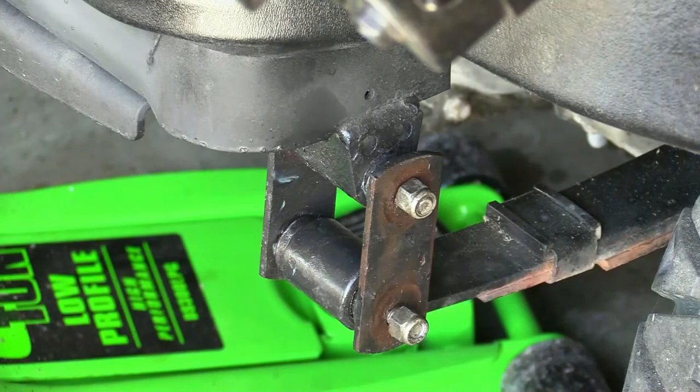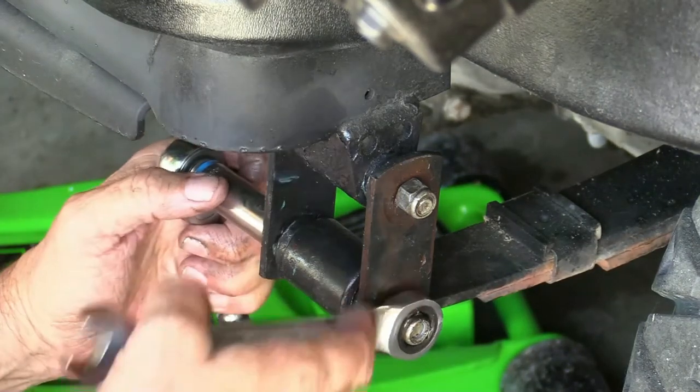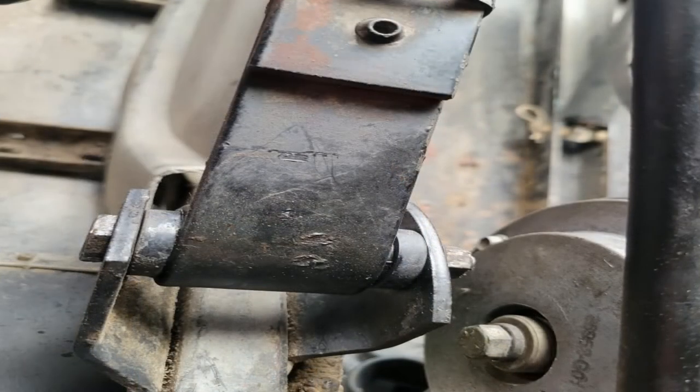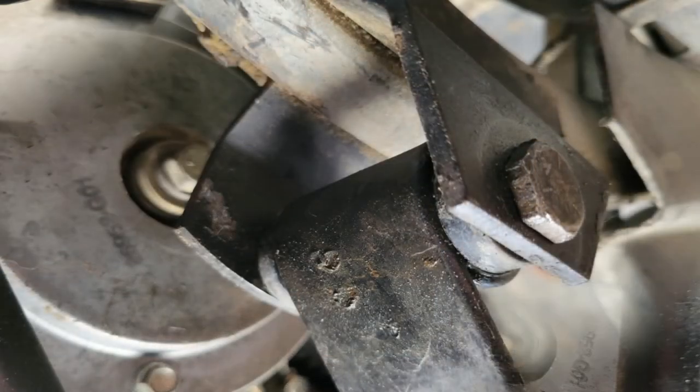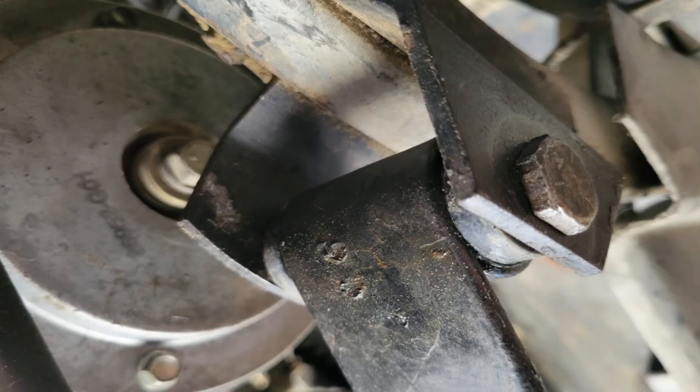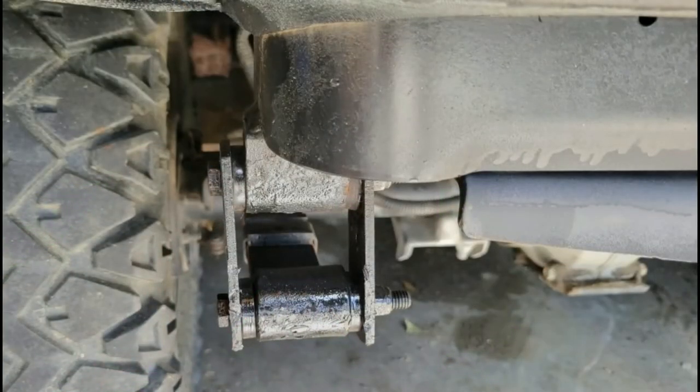For the front part it's the exact same procedure — I used the Harbor Freight Daytona jack to lift the frame and the bottle jack to help align the bolt through the holes. You can see from the still photographs it's the same process. Here's a still photo of the completed project. I had some difficulties without a helper, but by manipulating the jacks I was able to get it done on my own. Stay tuned — I'll do the front leaf spring in the next video, then the stereo completion, and we'll be pretty much done. Don't forget to click subscribe, give me a thumbs up, and thanks for following along!